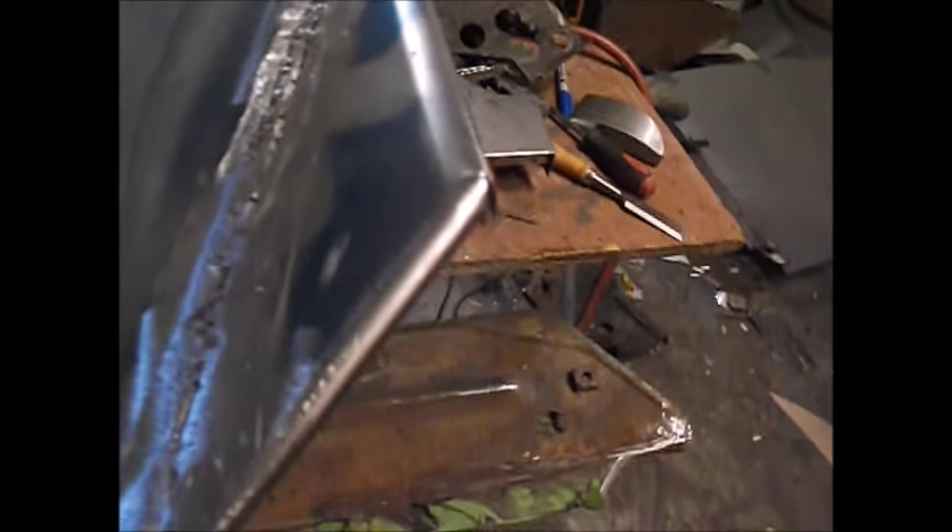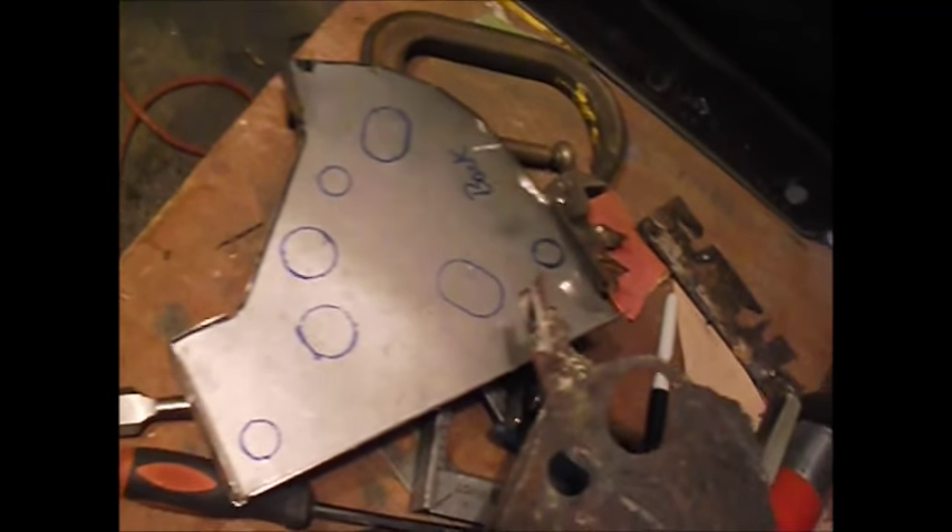Once I get the holes punched into the panel, I'm going to do my spot weld here, spot weld here. Then I'm going to use tech screws and pull that together as I spot weld it, and seam weld it all the way up inside there real good — that'll give the fender some strength. Then we'll fill in the gap. After doing those doors, that seems like a pretty easy proposition. There's our panels welded in. I'll pull the bench drill press out, use a bigger drill bit and work my way around the holes, then use a sort of grinder-router thing to clean them up and get them pretty similar to the old piece.